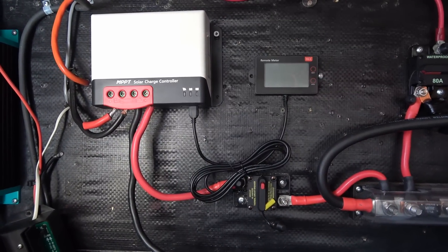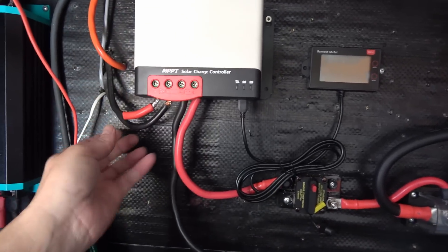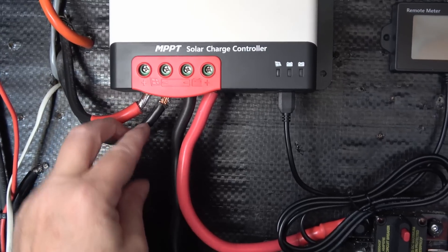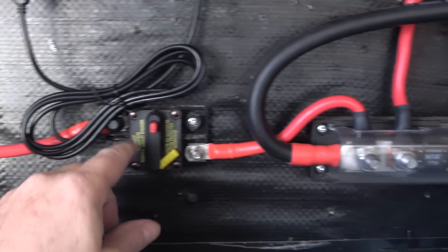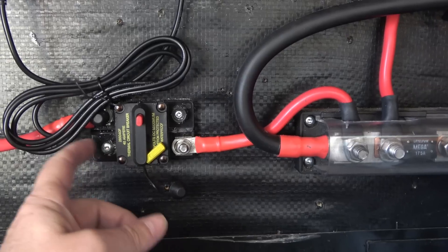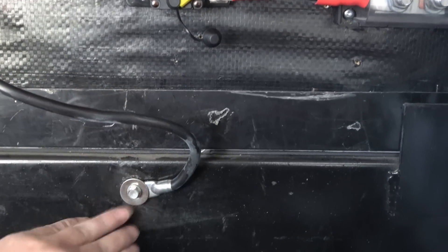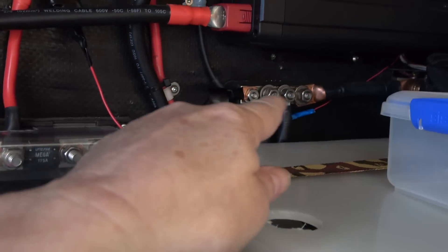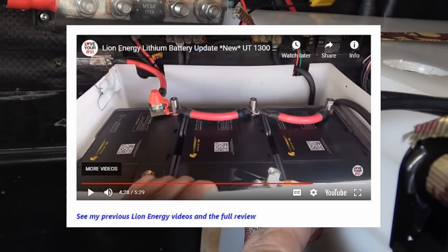Okay, got most of that wiring spaghetti out of the way and put some new spaghetti in its place. I mounted this up here — the wires coming in are from my rooftop solar panels, positive-negative positive-negative, and then going out to my battery negative-positive. The positive wires go through a 40-amp breaker that was in the existing system. It'll be interesting — I may end up blowing that if I get near 40 amps for too long. The negative just comes down to the frame to save wire, goes through the frame, pops back up onto a bus bar, through my shunt, and I've got my three Lion Energy 105 amp-hour lithium batteries in here.